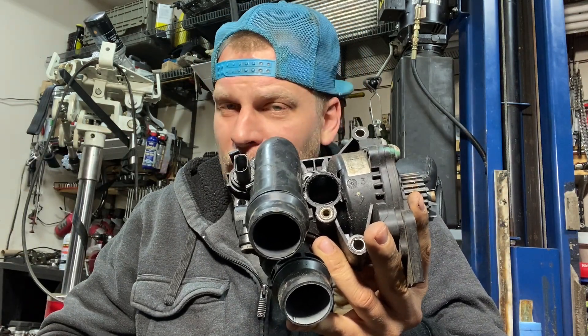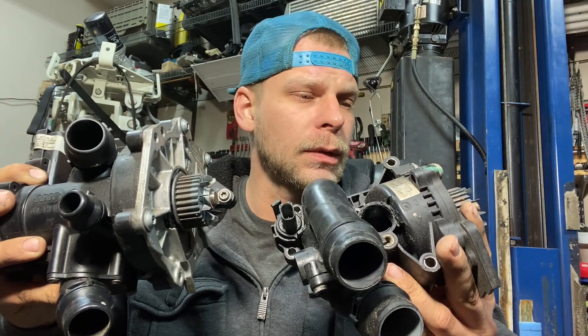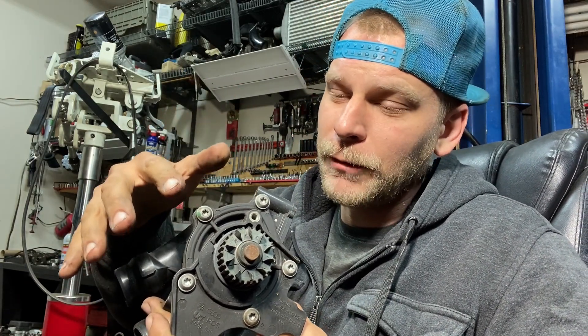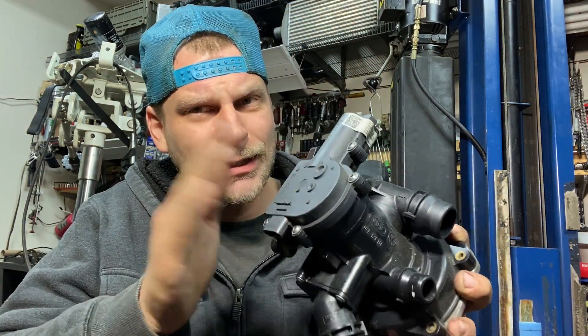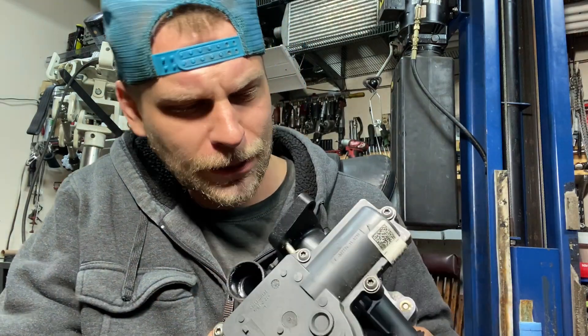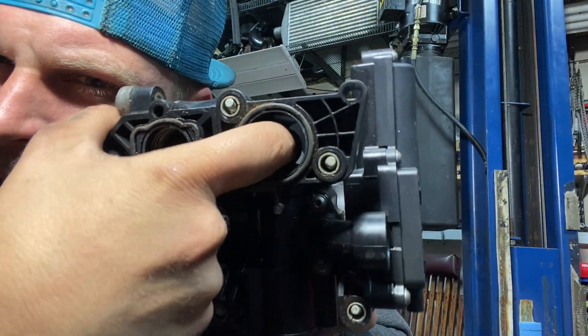This is a comparison video. I've never actually felt the need to take one of these apart, but today I'm going to show you the difference. There's a big behemoth of a water pump that goes on the B9 engine. This is the B8 or B8.5 — they're both 2.0T TFSI engines, but this is the revised, newer style engine. Now the B9 pump has some kind of crazy servo-type deal with balls and bearings that does some weird regulation. We do still have the coolant temp sensor tucked away in there.